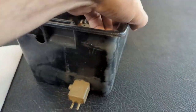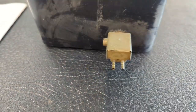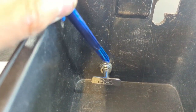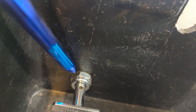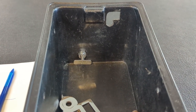I'll spin it around and show you the other side of the switch where the hoses go on. George was wanting to know how and where it was mounted in the glove box — that's where it is, George. It just has a locking threaded nut on it. The handle comes off with a small allen key, and the nut is actually a special nut with a trim piece over it. If you don't have it, any nut will work, but if you're buying these, try to get that nut too — these aren't that common to find.